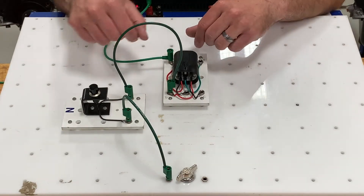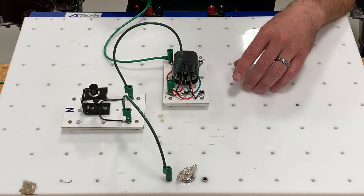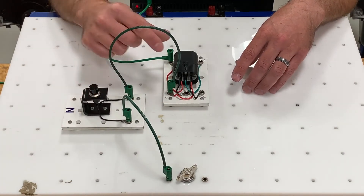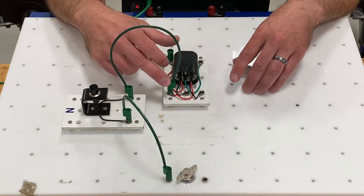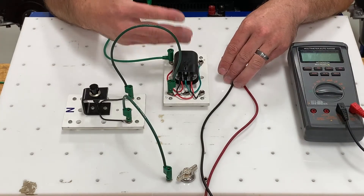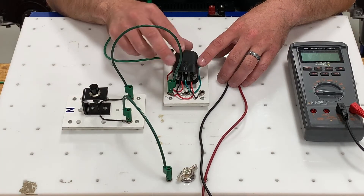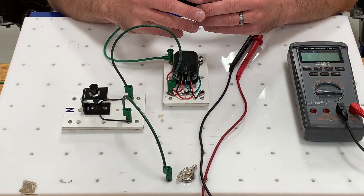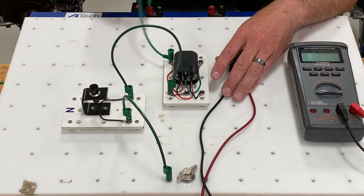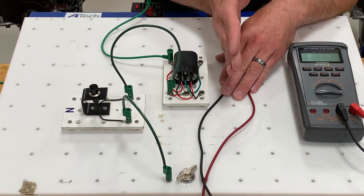What we've got to be careful about is that the audible click is just one part of the sequence — it's not a way that we can really confirm that this relay has the ability to function properly, so I need to go further. What I did was take 12 volts into the relay coil and provided ground through this momentary switch. This relay coil needs 12 volts and ground — it needs to be able to drop 12 volts in order to function. One of the things to really keep in mind is that internally there is no physical connection for electricity between the control side and the action side. So I provided 12 volts up here, but there's no voltage or current flow on the action side of the circuit.